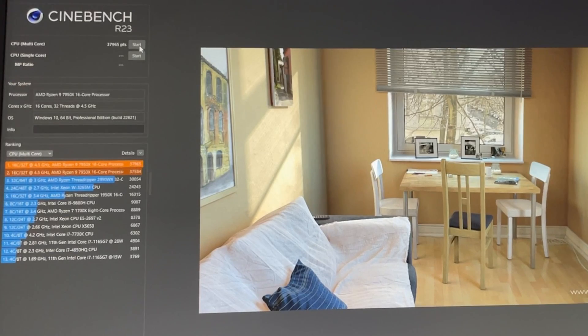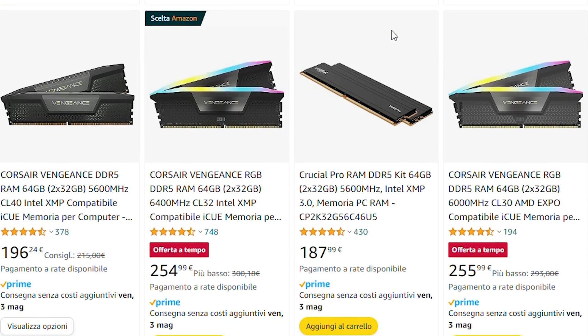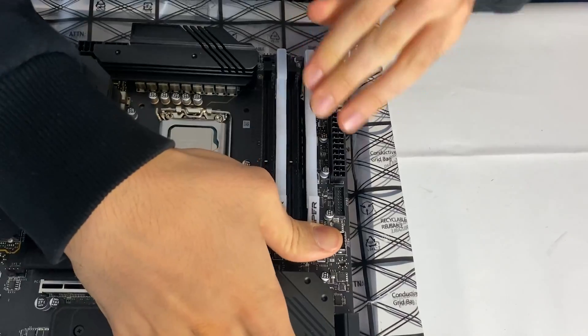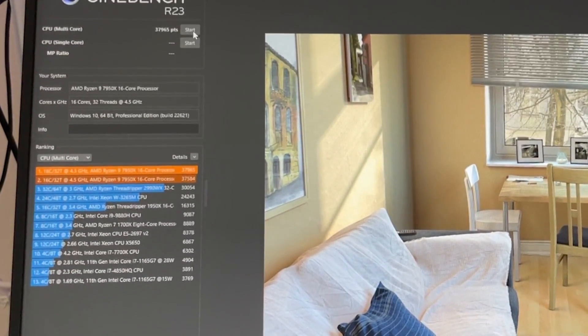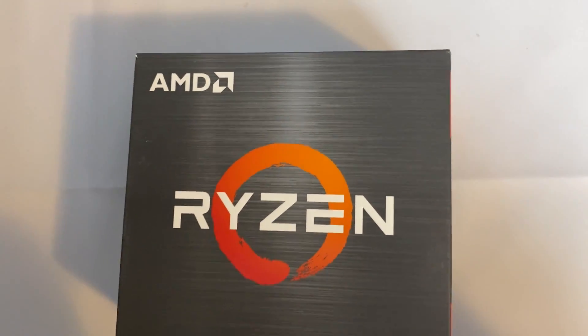At this point the choice is: if you need more than 32GB, do you get 48 or 64? Unless you're doing heavy productivity, it's pretty tough to saturate 64GB for gaming, so 48GB is probably the better gaming choice. However, there's something strange in the market right now — you can often buy 64GB kits for cheaper than 48GB kits. The issue is that 64GB kits are very high-density sticks produced early in the manufacturing process, so they generally clock lower or clock the same with higher latency, meaning you effectively lose performance. DRAM tuning can get you 5–10% more performance, which is significant — like an overclock on the CPU.